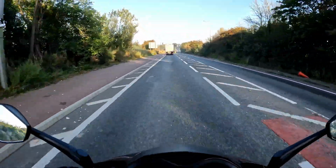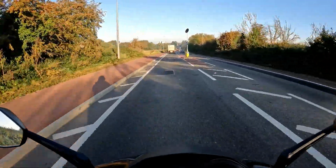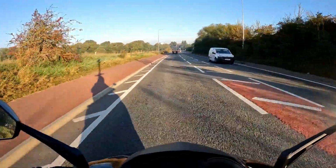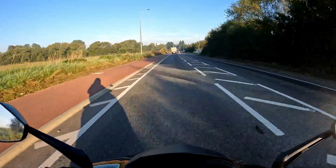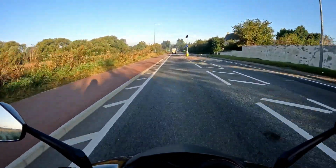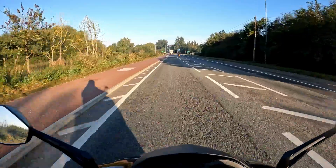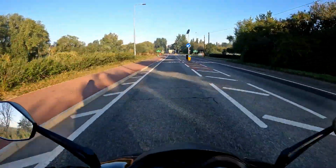So back into the town we go. One final test ride day before we hand over to customer, as we always do. 2 test rides on every bike, minimum of 10 miles. Another set of bolt checks for me today to sort it all out, make sure everything is absolutely bolted up, tyre pressures, and check absolutely everything on the bike.